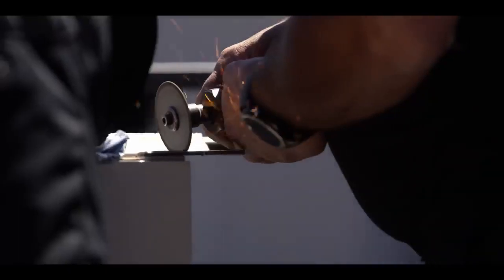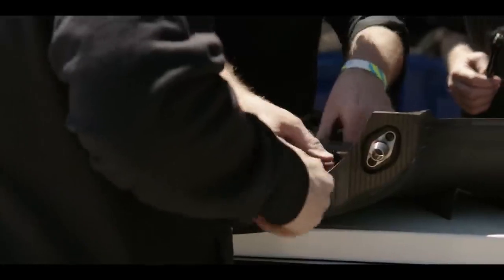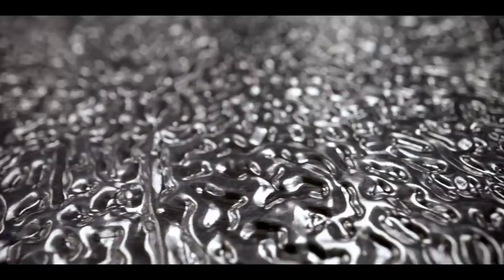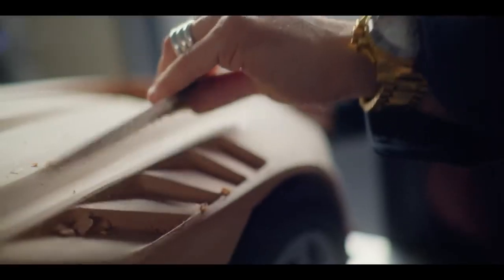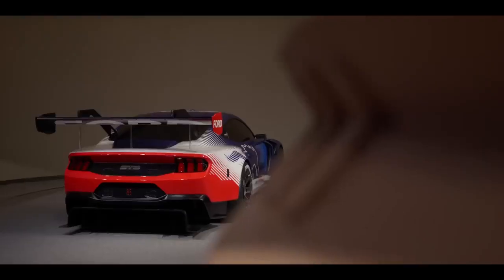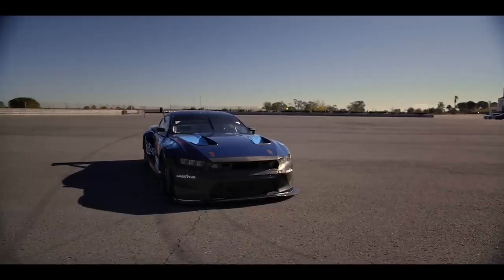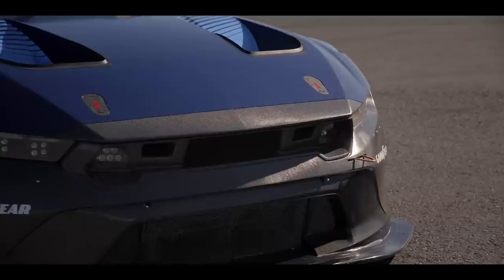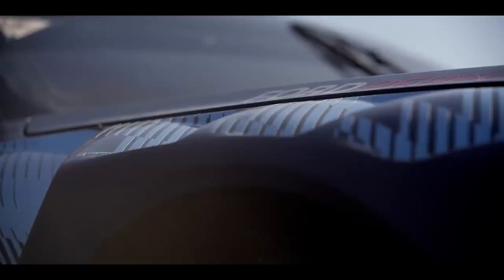At Sebring we had some issues with the first version of the bodywork, but we quickly recovered. The development path is a lot faster because you can make rapid prototype parts literally overnight. When you go through the development process, particularly on the scale model, it's probably 80% of the parts you make and test that you throw away. The ideal scenario would be a smaller car — the Mustang has a pretty big frontal area, but we found some good tweaks to overcome this, and in the end had to bring back some drag into the car to actually be in the FIA box for the aero requirement.